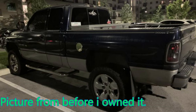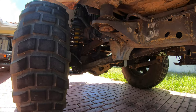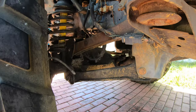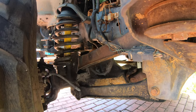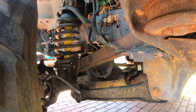The budget mud truck is a 2000 Dodge Ram 1500 with the one-ton axles off of a 1997 Dodge Ram 3500. The front axle is basically held in its spot by four control arms — two on each side — and one track bar. The control arms control up and down movement, the track bar controls left to right. The actual suspension bits in the front are just the coils and the shocks, so technically to lift it you just need new coils and new shocks, but depending how far up you lift it is when other issues come into play.